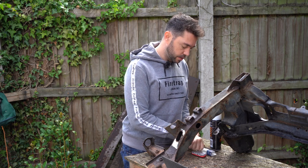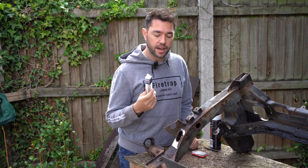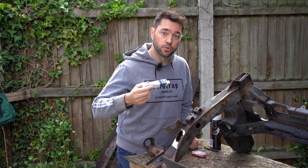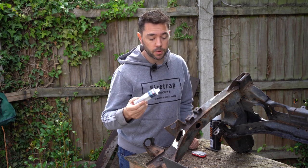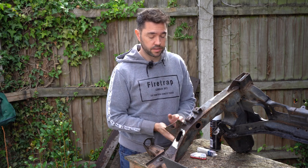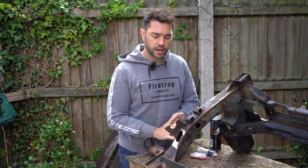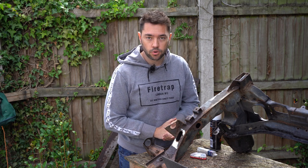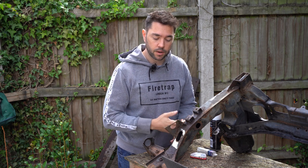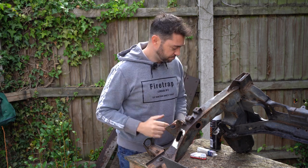And if I'm not getting any joy with that, I've got some left-handed drill bits, so that as I'm drilling into the center of the stud, there's a chance that it could unwind it, unlike a regular drill bit, which might tighten it. And then I've got some screw extractors, which I haven't got much faith in at all. Failing all of that, it's heat. And I did see one video that uses a Torx bit. Once you've drilled the hole in the stud, tap in a Torx bit and that works wonders. So hopefully we don't get that far, but we'll see.